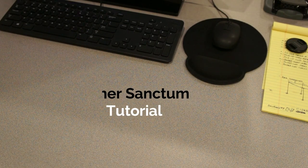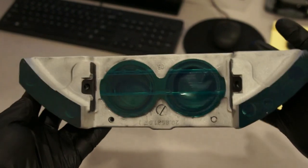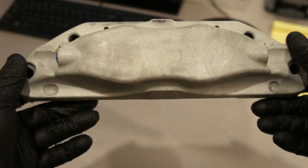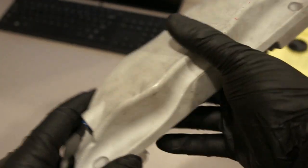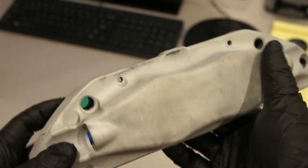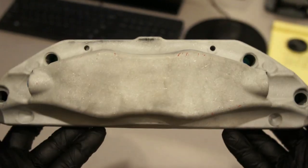Today we're going to be going from something like this, freshly sandblasted, has a nice profile to it. We're gonna clean it up with some acetone, go ahead and stick it in the oven, get it outgassed, clean it up with a little bit more acetone, and after that, blow it off with some nice dry air, and begin the coating process so we can end up with something like this.